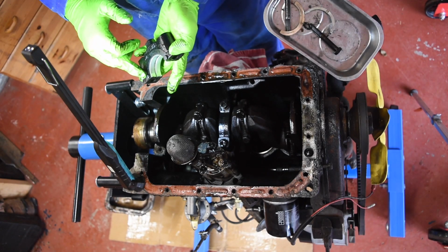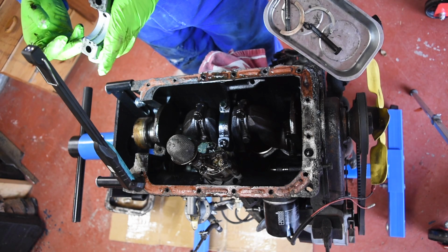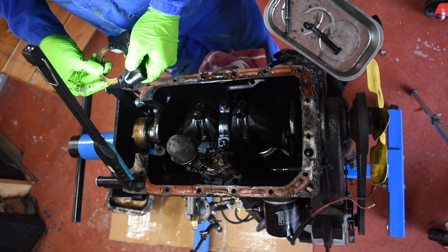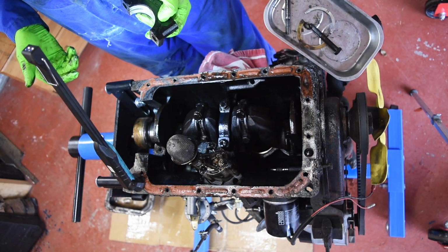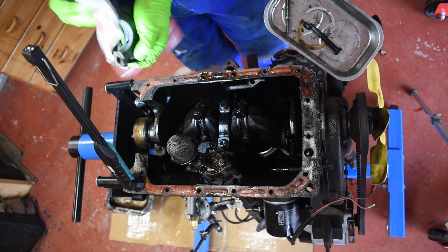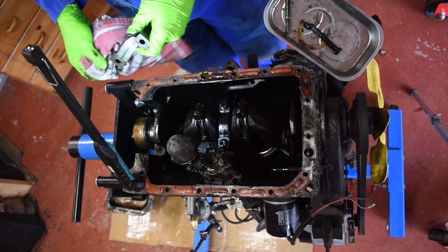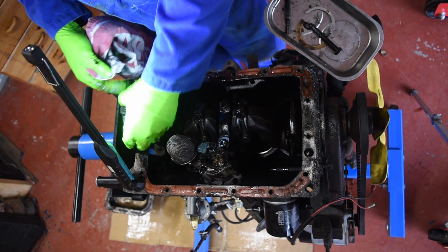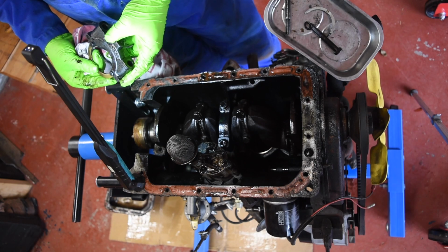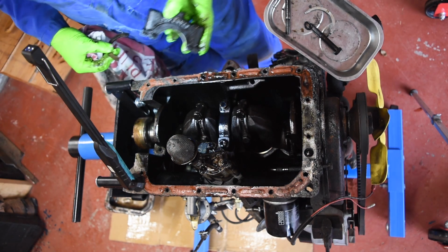we have some bolts here. They're not normal, are they? Well, I'm pretty sure they're not normal. I think it's probable, well, my guess now is the crankshaft has hit the block at some point in the past, and this DIY thrust washer has been an attempt to salvage it, which is really sad if that's the case, because this is the car's original engine.